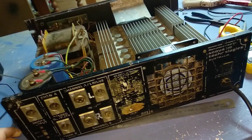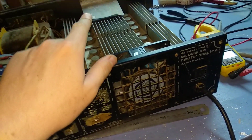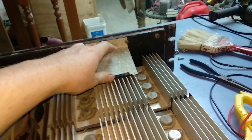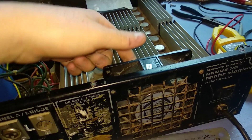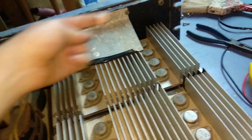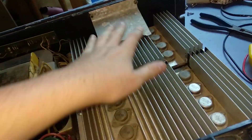The first thing I did which greatly reduced the sound output was this fan originally was an intake fan — I'm pretty sure it should have been an exhaust, but I have already swapped it around. I also made up this shroud. What this was for was this fan was originally — I think the idea of the previous guy who modified it — to blow the air straight over the heatsink, but since it's intaking now, the air that intakes goes in every direction evenly, whereas air that blows out of a fan just goes in one direction. So the idea of this was to bring in as much air as possible and focus it over the heatsink.